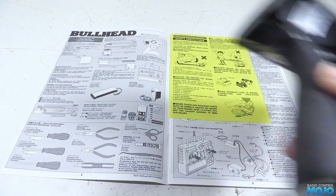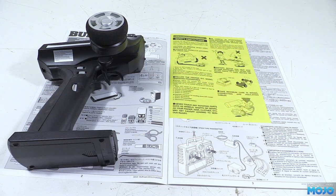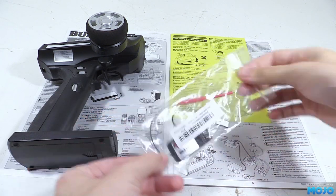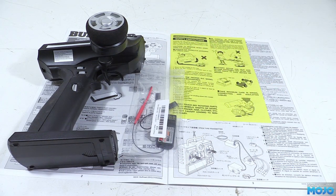For electronics we're going to use a Flysky GT3C with modified firmware. The stock GT3C will work well too, but with the additional features from the new firmware we can run more channels and control two steering servos independently, as well as twin ESCs with all sorts of fun tricks. The receiver is a Flysky six channel one.